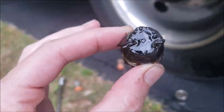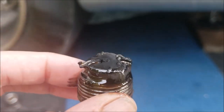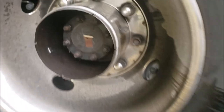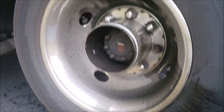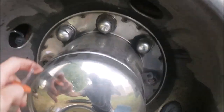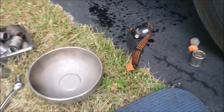There are no great big chunks but I don't like it. I don't know how many miles are on this one — I'll ask Boner and see. Next thing we've got to do is see about pulling this axle out and finding that leak. I should point out that if you want to take this cap off, there are some little notches — little flat spots — you can get in there with a screwdriver, give it a twist, and pop it off. Once you pop it off you've got a place to put all your parts.